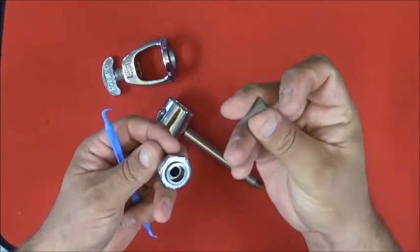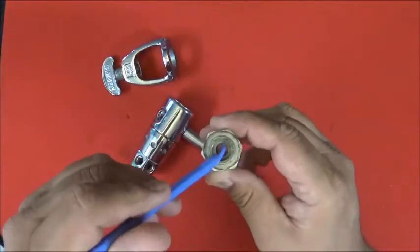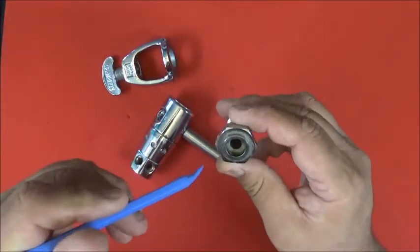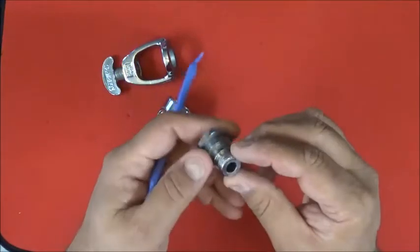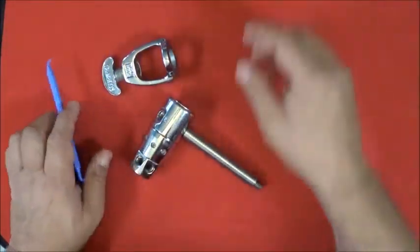Then you'll have the filter — it should come right out. You can clean yours up or reuse the one that comes in the kit. Normally there's a number 12 O-ring that backs that up — it's basically just a little buffer for the star washer. It's not in there, but no big deal.